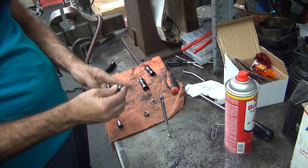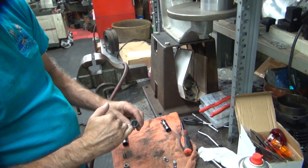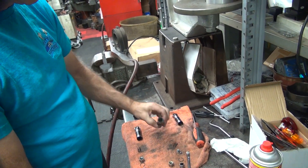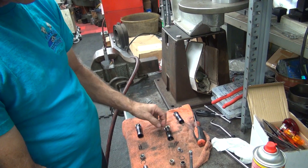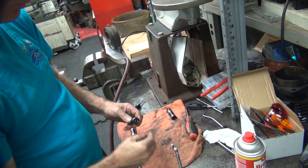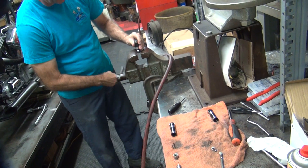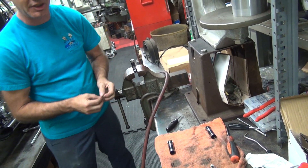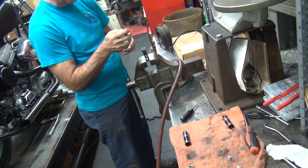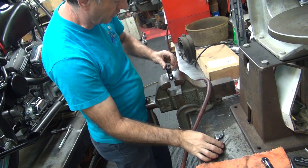It was sticking slightly. I can't see any way that sticking would cause a problem because it wasn't that much — but just in case, this one doesn't stick. Could that be enough to make the tapping noise? The tapping noise goes boom boom boom boom like that when there's no hydraulic underneath. I don't know how much hydraulic action adjustment we need in the pushrod to make this thing bottom out. We can put it together dry or with parts — dry means not putting anything in there yet.